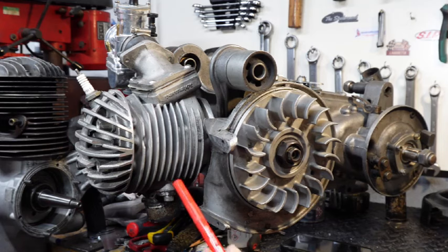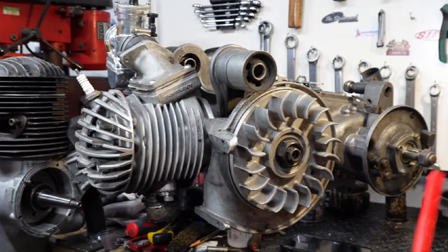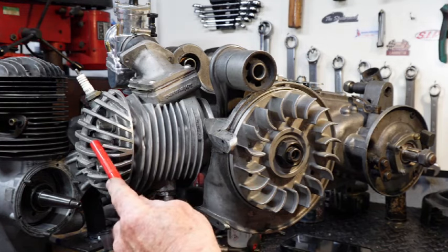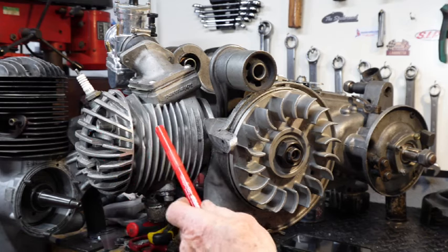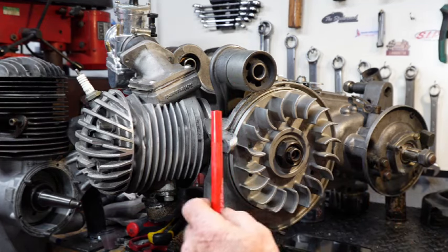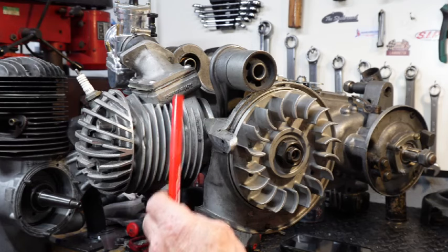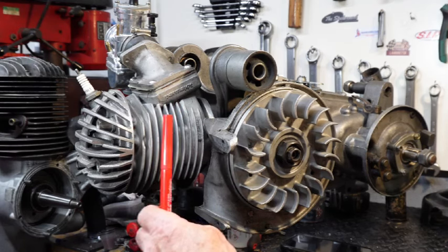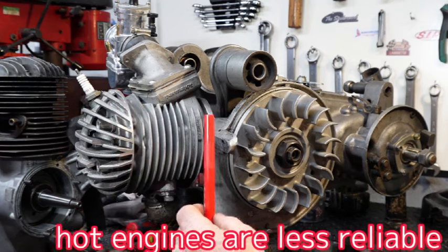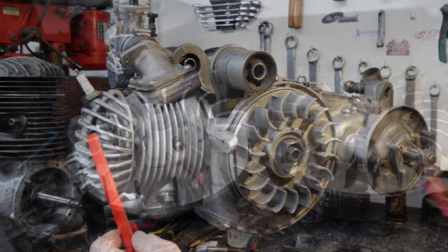Airflow is really important, and then we come to conduction. Aluminium conducts heat very efficiently, so whatever heat is made in the top of the cylinder head will be transmitted down into the barrel, the piston, the con rod, the crank, and the whole engine casing. If you put two pieces of metal next to each other they will always try to equalize, according to the second law of thermodynamics — heat always passes from the hottest metal to the coldest until they equalize, and then it stops.